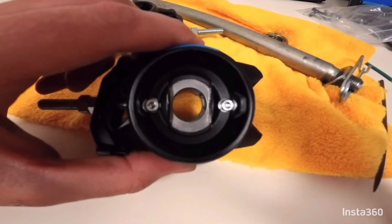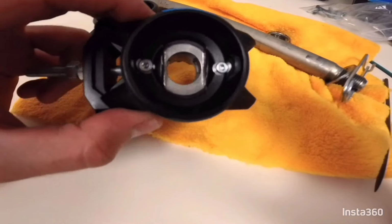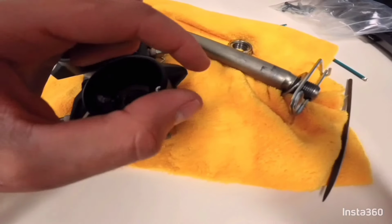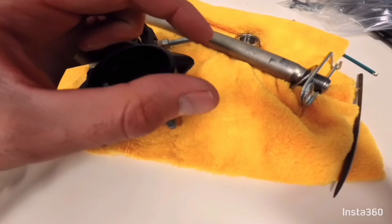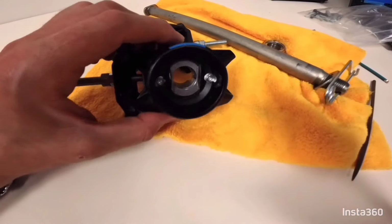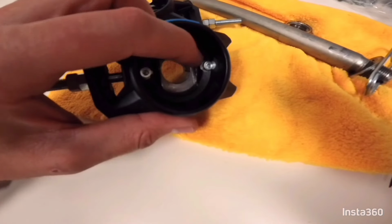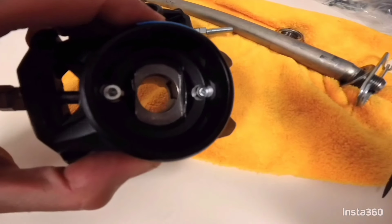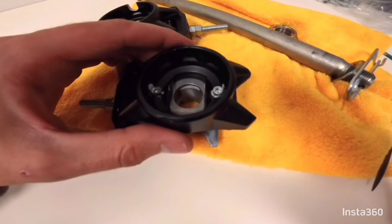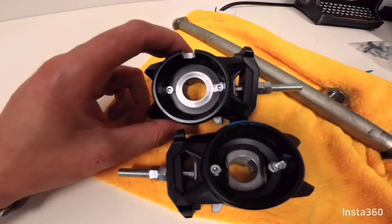That's the aim. There is a part to be added to the actual wheel itself, which we call captive spacers. Those collars, the spacers that sit on the axle, you can get a version with a lip on it that sits in the oil seal on the bearing of the wheel and stops those falling out everywhere, which makes, again, such a difference when we're changing tires. So, as you can see, this is the right-hand side of the bike, and we've got those in there. I did use a milling bit just to make sure that the heads of the bolts could sit flush. And I'm kind of liking this solution. I'm going to try it out, install it on the bike, and we'll show you how it goes when I get there.